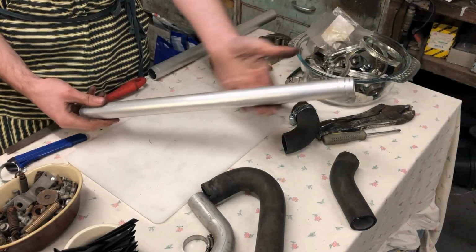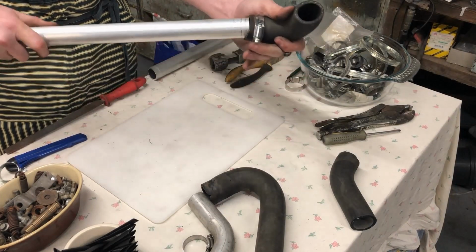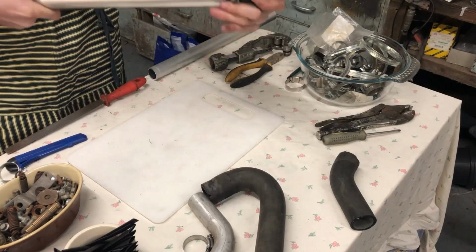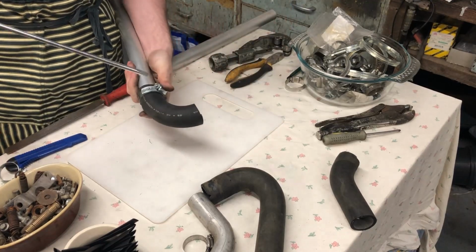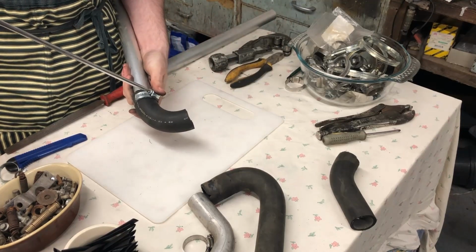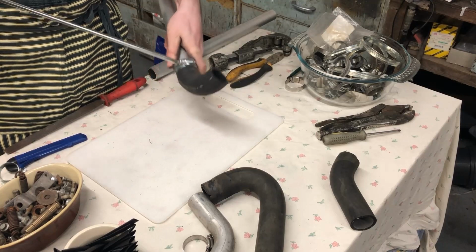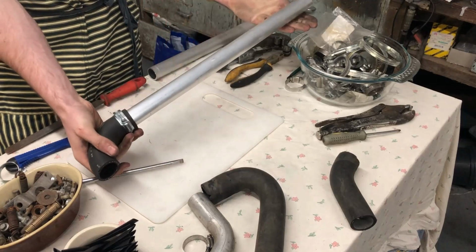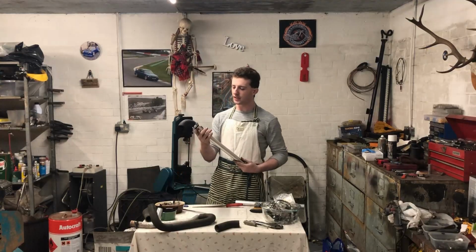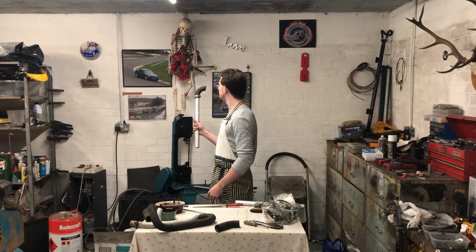Well, now that we have our coolant hose made up and beaded, it's time to mix our ingredients together. So we're going to take the coolant pipe, just pop the hose in, to the end, over the bead, tighten up the Jubilee clip, and there we go, one coolant hose that isn't going anywhere. Well, now that looks like some good old free range healthy coolant hose to me, wouldn't you say, Arthur?